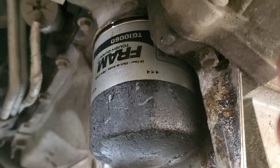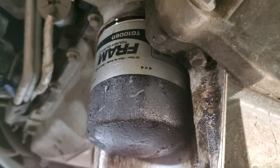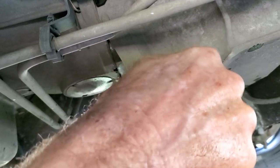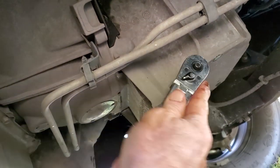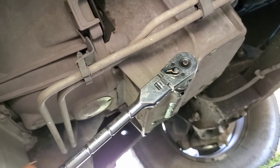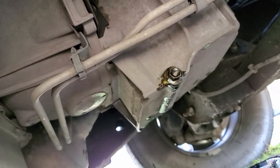We're ready to put oil in. We've got our oil filter put back in. Let's go over on the other side and put the plug back into the oil pan and we're ready to fill this up. Let's put that oil nut back into the oil pan. Get it on there good and hand tight. Now we'll take the wrench and tighten that up. Taking your 15 millimeter socket, getting it on there and just snug it up a little bit. You don't want to over-tighten it, but just snug it up. Next, we'll clean off a little bit of oil that dripped down and we're all set to go.